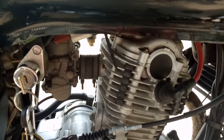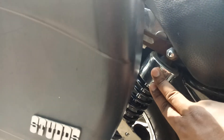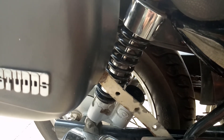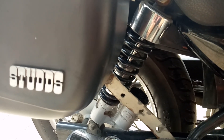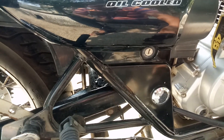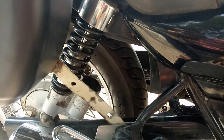Now coming to the next part: I have installed endurance shock absorbers from the Royal Enfield Bullet Thunderbird 350. These are nitrox shock absorbers from the Endurance company, and they costed me around 2500 rupees, sourced from a friend in Ahmednagar since I couldn't find them in Mumbai. This resulted in a height increase which was very helpful — the silencer used to brush against big speed breakers, and that problem has now been eliminated. The travel distance of these shock absorbers is very large, so comfort has increased.